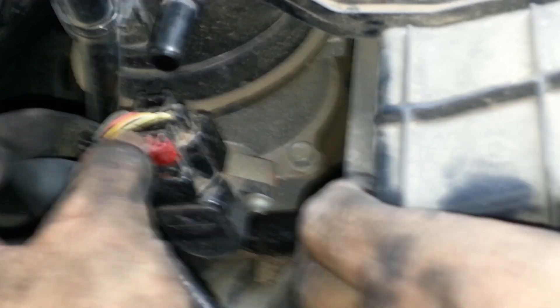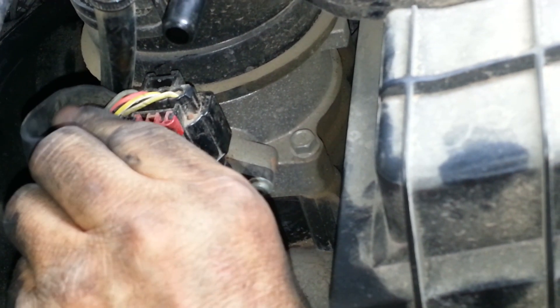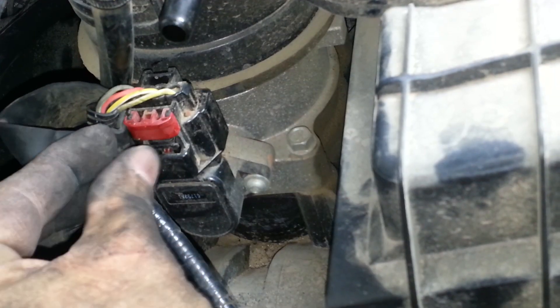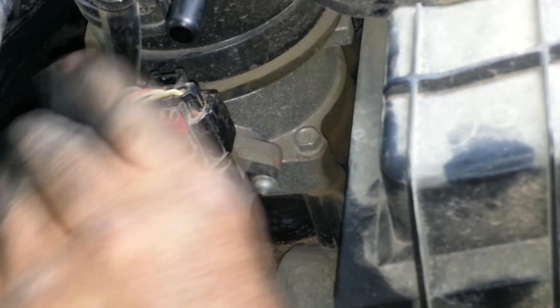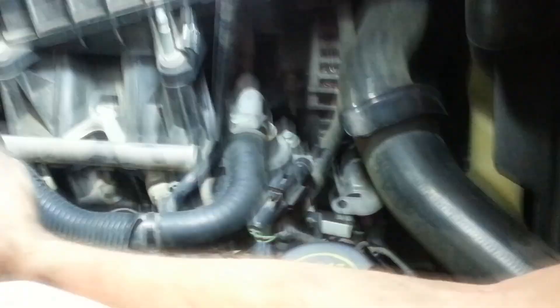Okay, that one is out of the way. Just put it out where it's not going to bother you. This one right here has a little cover — all you do is lift up this cover. You've got a little red safety lock right here, and you just want to get a screwdriver and lift it up. Then put pressure right here, push it in — you can feel it release right there — and just pull it up and it comes right out. Remove it out of the way. Now all this area right here is ready — we just need to remove these two bolts off of the fuel rail, and then we're going to be able to remove the fuel rail and get our fuel injectors out.